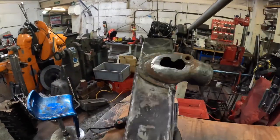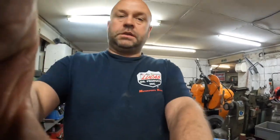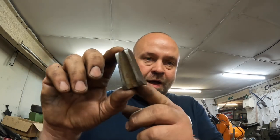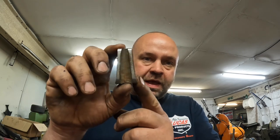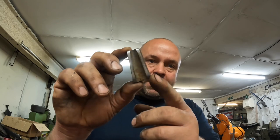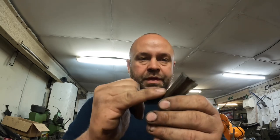I've prepped the hole in the bottom of the radiator and because it's cast iron I need cast iron to weld in there. I've got this bit of cast iron here — if you can leave in the comments section below what you think it is, I'll answer it at the end of the video. I've cut that bit of cast ready and now I'm going to dress it to make it fit in that hole. Because it's an I-section I could basically shape that part and that part once it's installed to make it hopefully flow with what was originally there.